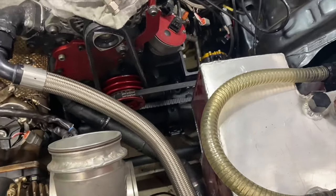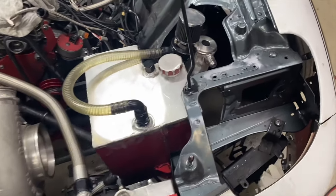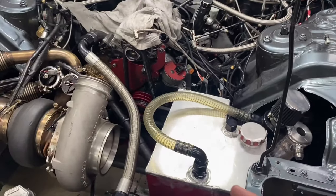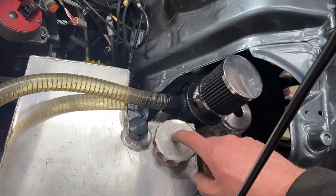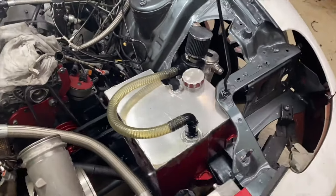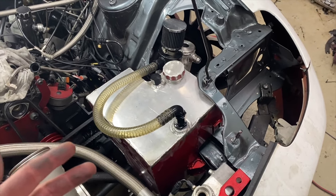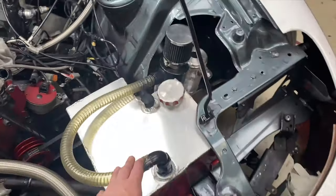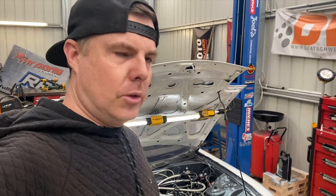It's got a little indicator on the side like my other catch can does. I wanted to put it here originally but once the intercooler pipe was fitted it fouled the blow-off valve, so it'll go here instead. You can see there's currently a single breather, but I'm actually going to put another breather in the top of the cap that'll come down and connect to that port. So we'll have two breathers — one at the front of the tank and one basically at the rear — along with the modified tank bottom and the outlet exactly where I want it.